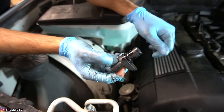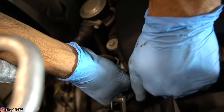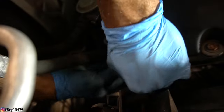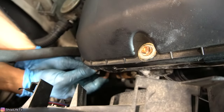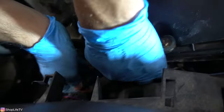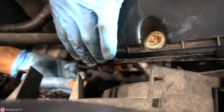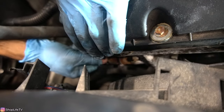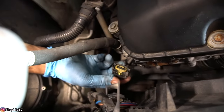Get this O-ring lubed up and let's put it on. You might have to feel for the hole a little bit. Once you have it started, play around with it until it goes all the way in — you might have to twist and turn a little bit too, and you will feel it bottom out. Once it bottoms out, twist and turn the sensor until you can get the bolt in the hole. Hand-thread it first. The last thing you want to do is plug the connector in.